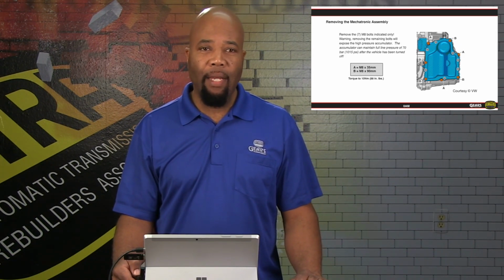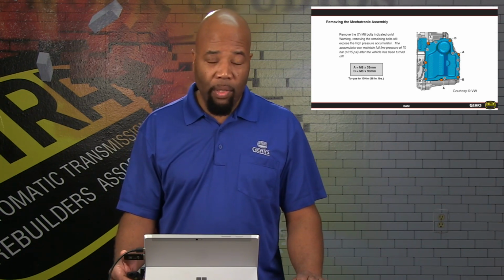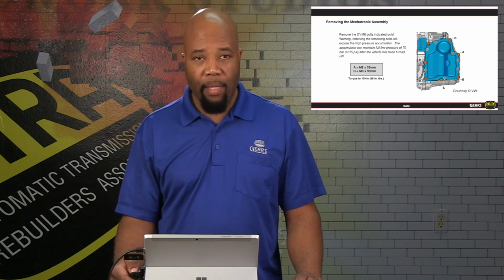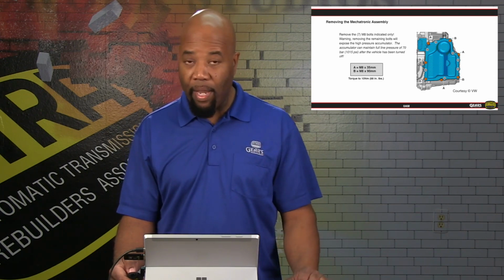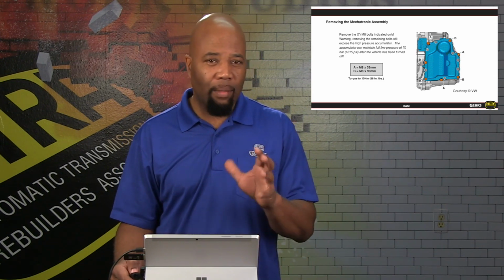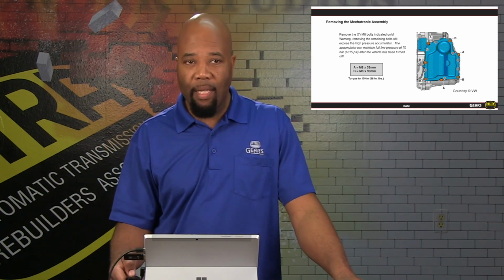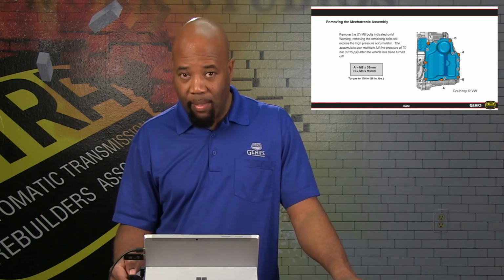The cover that's on there is going to be like a protection. If you look at the bulged area, that's where the high pressure accumulator is located. So that area could be distorted because the accumulator could have failed, and you will see any damage or anything happening right there. It might be obvious or it might not be obvious at all, but that's sort of like a blast cover, if you will, so that if there is anything that happens with that, you will be protected as long as that cover stays in place.